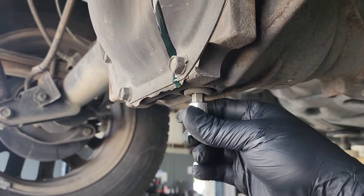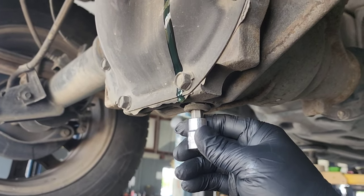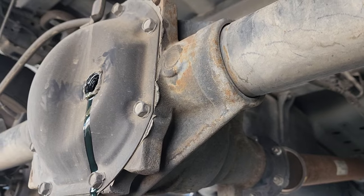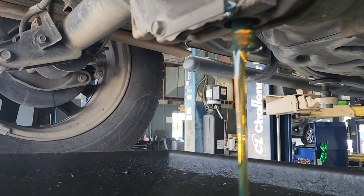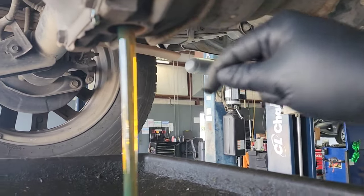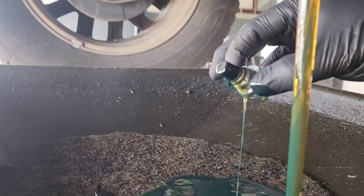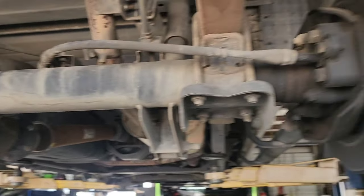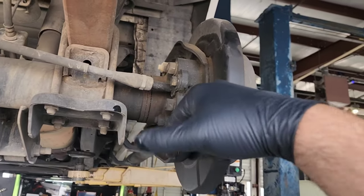Slowly take this bolt out. Man, that fluid looks clean, but remember, y'all paid attention to the short — we have a leak. It's not too bad right now, but it got stuck. Let's knock it down. Take a peek at the plug — it doesn't have a whole lot of metal on it, so I think we're good. Let's get on with this axle seal replacement; I might replace the whole axle. Y'all will see why.